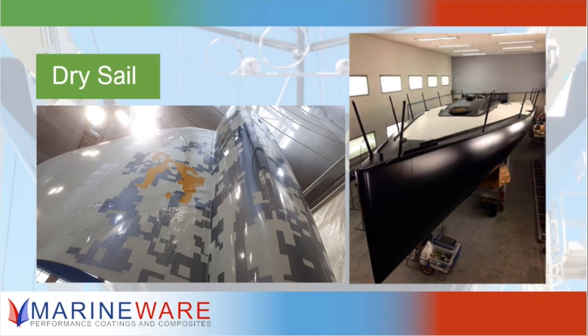It was in very poor cosmetic condition. It didn't require a full fill and fair but we patch-filled it, boarded it through, and then went into a Duropox grey primer to give us a view over it — almost using it as a guide coat to check the fairness before going for the black over the top. We sealed all our fillers off with Duropox grey, then took the grey Duropox up to 240 grit before putting the black on.